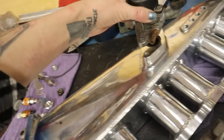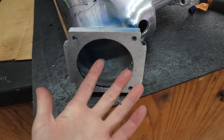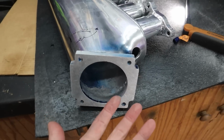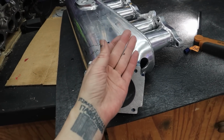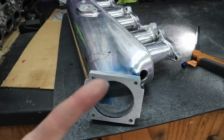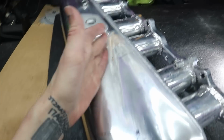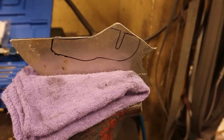And then lastly, also, forward-facing intake manifold. So what's gonna be moving? My throttle body, obviously, which is gonna be moving what? My throttle linkage, my throttle cable. And there's nowhere on here that is supporting the throttle cable. So it could either run underneath and run into this and rub on the bottom, or I could make a little bracket to hold it, which is what I did.